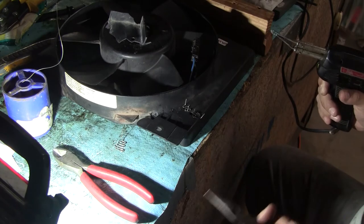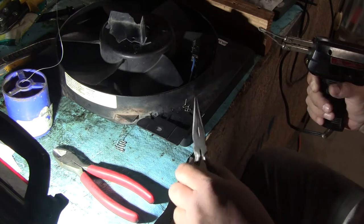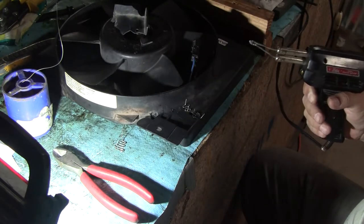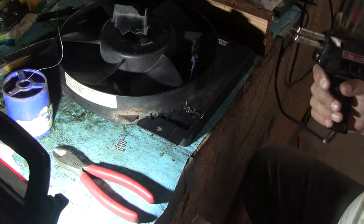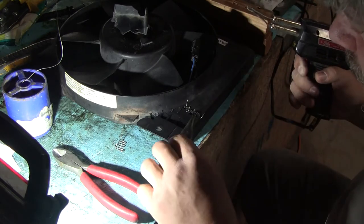I think it's probably, I'm going to say, not knowing it yet, it's probably better to push it in not as far as you should, because when you take your spare plastic and put over it, you've created a nice repair. I'm using exactly the same plastic that this fan shroud's made out of. You got to use the similar material if you want similar strength. So, all right, here we go.